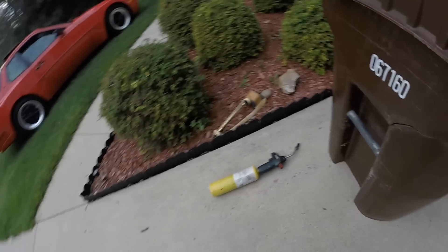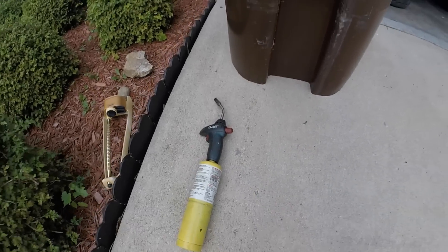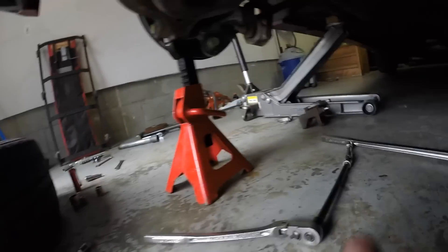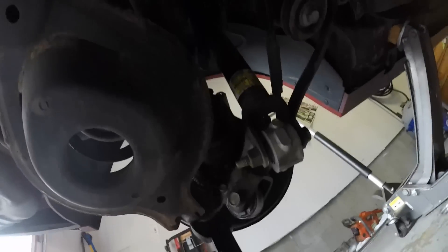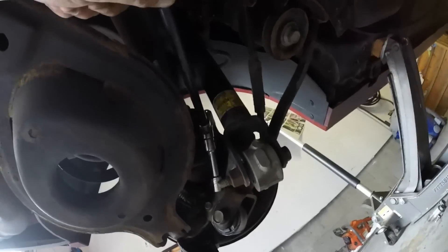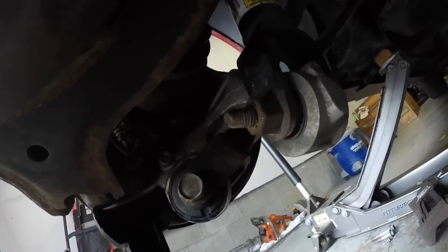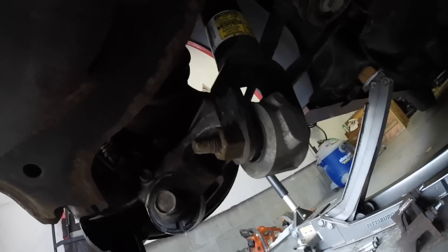Let me show you the mini torch I have — you can pick these up at Walmart or sometimes grocery stores, they run about 20 bucks and they definitely come in handy getting those old bolts loose. Here's the extension and ratchet combination I went with for that bottom bolt. I started out with the breaker bar on it, and once I broke it loose I switched over to my ratcheting breaker bar and the bolt came loose. You want to hurry up because once the bolt starts to cool down the Loctite or rust starts to harden again and it gets really hard to remove.